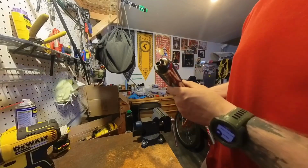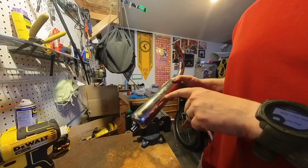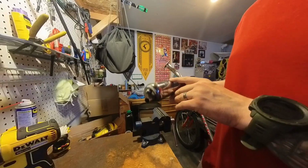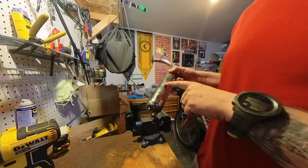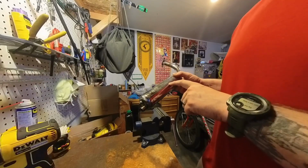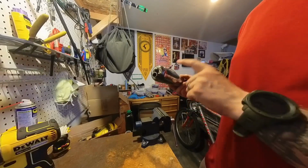Also, I'm going to clean this out. This is actually the original stock pipe that came off a La Schusa, so that would have been the Sutec motor, and the gentleman who had it before me ran it super heavy with oil. I think he was running a 20-to-1 ratio, so this thing's been dripping oil ever since I had it. So I'm going to try to clean it out a little bit, maybe with some gas and carb cleaner, to break up some of the deposits in there and help the flow a little bit, plus we're going to drill a hole through it.